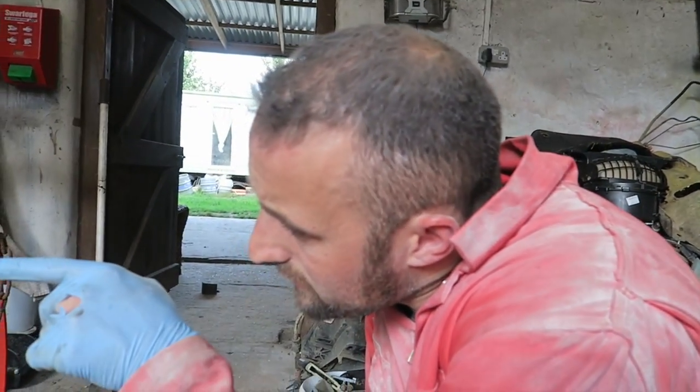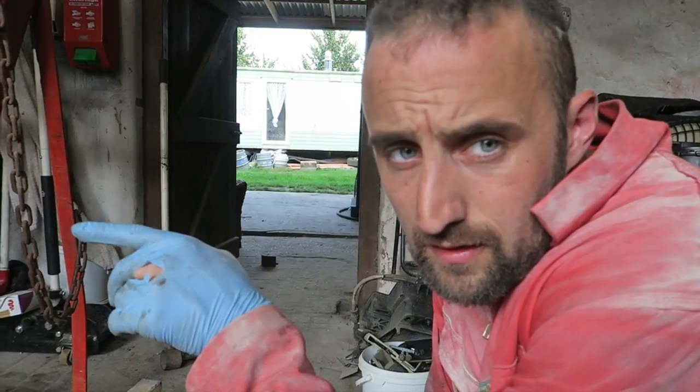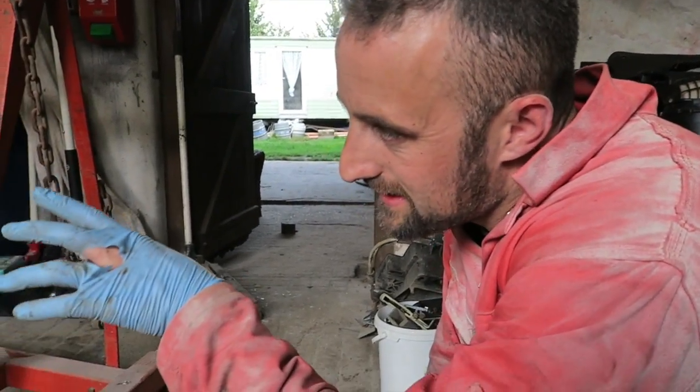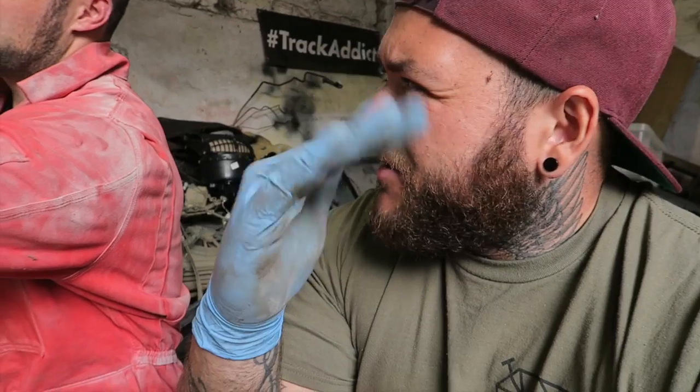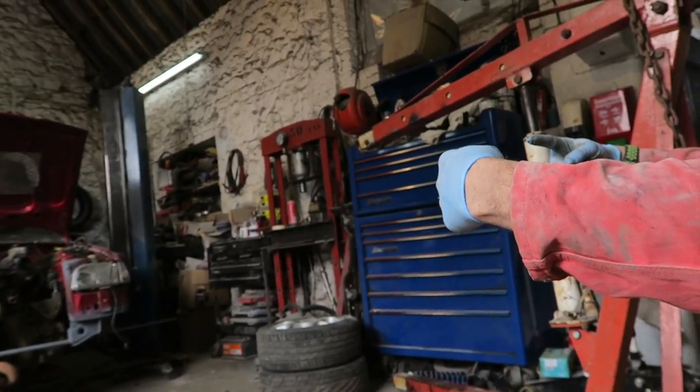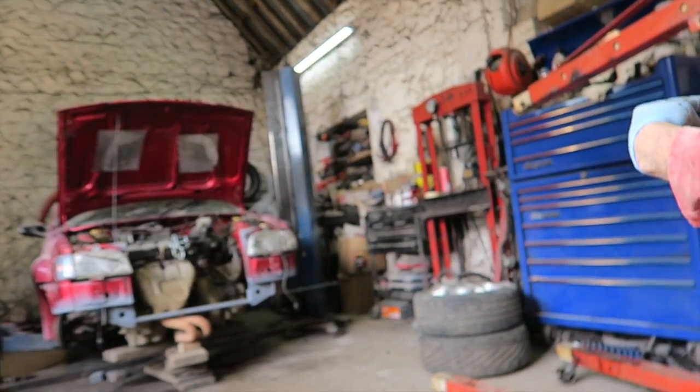No, but now what you remember is when you put the wheels on, it compresses up. The shock and the wheel are going to go higher up, which means the drive shaft will then move. So we need to get the engine higher so that it comes a bit more like that angle. When it does go, it'll meet it when it comes down to the ground. The engine just isn't quite high enough.